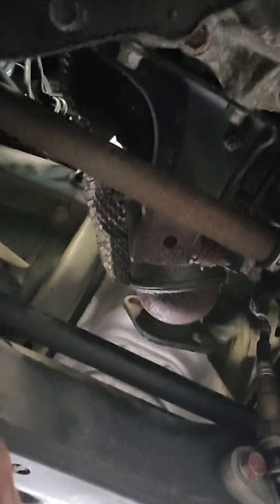The reason they put that spacer on there is probably because the aftermarket cat didn't work. You can see where it pressed the O2 sensor right into the bottom of that spacer. The voodoo black magic — you can trick the PCM with this stuff if you know how to set it up and use it right — but you're not fixing the problem that caused the P0420. That requires finding out: does it have bad injectors, a bad head gasket, carbon on the intake valves, misfires? This only works if your engine is running properly.